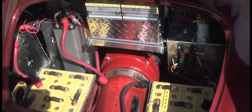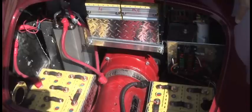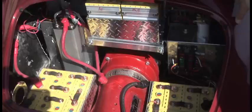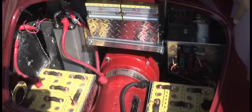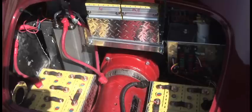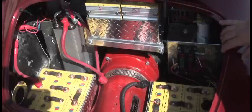On either side of the motor we have our Thunder Sky lithium-ion batteries. These are a new kind of battery that I think make electric cars viable in a way that lead acid simply didn't. We've arranged four cells to a battery, eight batteries in a bank — one bank in the front of the car and one in the back — and that's allowed us to achieve a 50/50 weight distribution. The total weight of the batteries is 489 pounds. If we did 16 Trojan lead acid batteries that would be about 1,350 pounds. So you can see that the lithium ions provide greater power in a third the weight, making the car really viable.